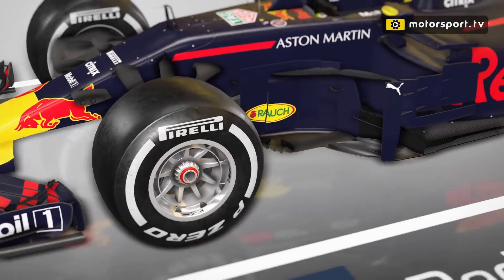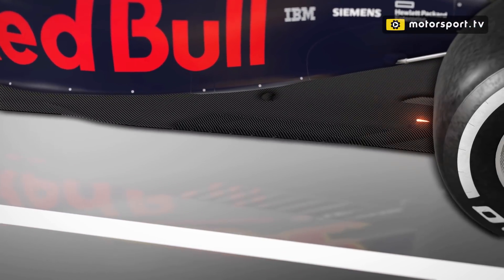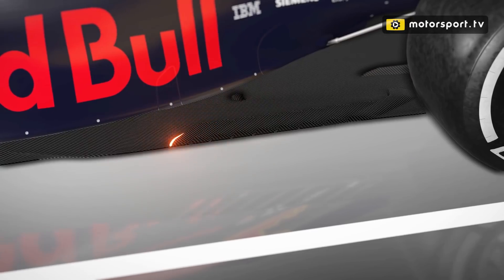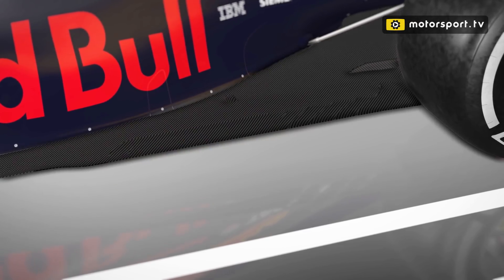We'll see this throughout the rest of the season, Red Bull playing just with the flaps, not changing the rest of the structure of the front wing, in order to tailor it for every circuit. As well as changing the front flaps, they've also been playing with the floor along the edge in front of the rear tyre. This has been an interesting area of F1 development for many years, especially now that the cars are wider and the floor is more open to exploitation with aero devices, and the number and shape of the slots they can put in the floor.